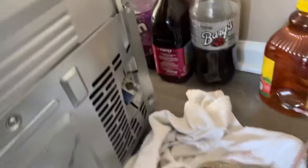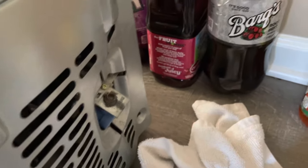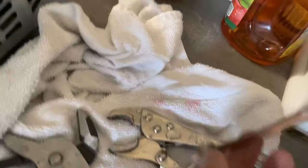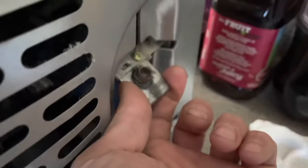It's calcium buildup in here in the back. What you're gonna want to do is unscrew this right here. Mine wasn't coming off so I had to use pliers here and one on the nut right here. You don't want to force it and break this plastic mechanism that's in there, so make sure that you have it held tight.